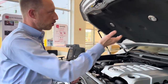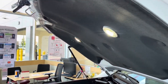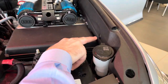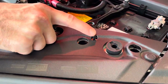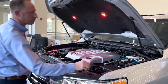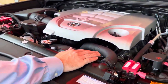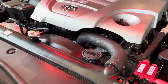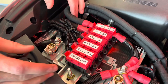Underneath the hood, back to the lights — we have hood lights in white or amber, controlled with a triple toggle switch located next to the fuse box. There's also an override pin trigger here, so if you accidentally shut the hood with the lights on, you won't drain the auxiliary battery. We also have front and rear diff breathers — the front one is located right here — and a couple of extra fuses located on top of the auxiliary battery.